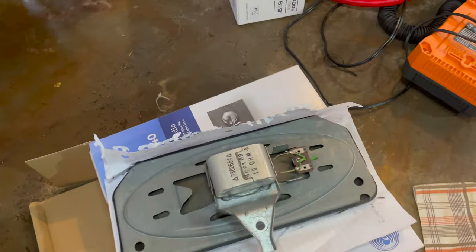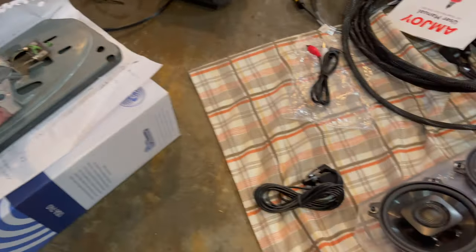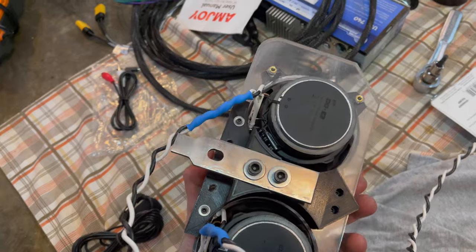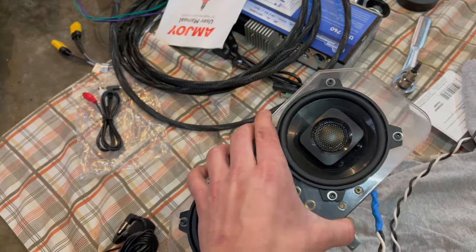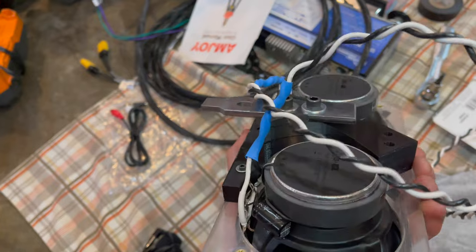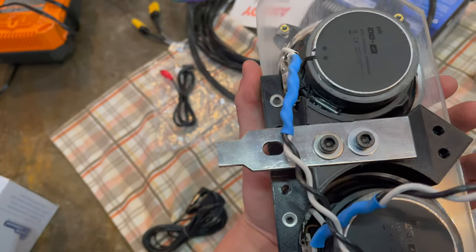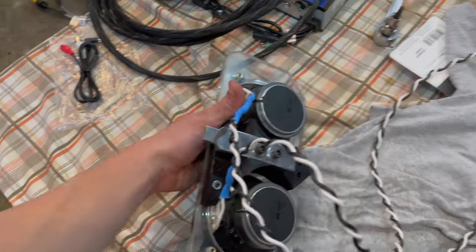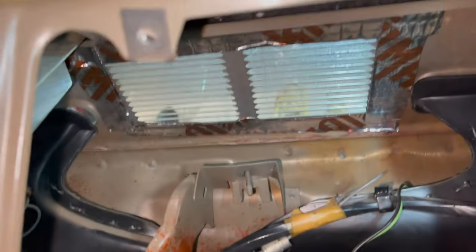Here's the previous dash setup — it was a four-by-ten with a mounting bracket that stuck out to the firewall. We're running stereo now so we've got two coaxial four-inch drivers, and I had to build a custom plate to match the installation style. We have laser-cut acrylic baffle panels, the speakers are threaded into 3D-printed mounting posts with threaded inserts, and then a milled steel extension bracket that slides out to the bolting mount location. Speakers are soldered, all wires are twisted and have XT-60 connectors.